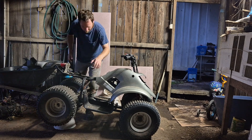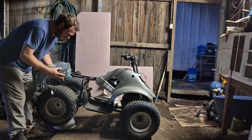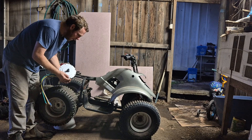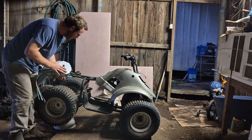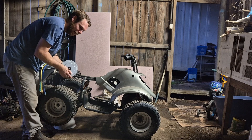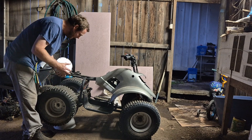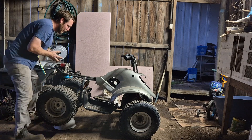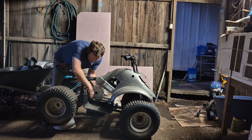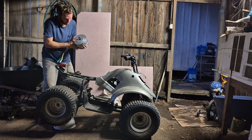So I'm going to be mounting the electric motor in here. This is the electric motor that's going to go in there. It's a 3000 watt motor and I'm going to be running it at about four and a half to 5000 watts — it's a 48 volt motor. I've got a custom made lithium battery for it, which I'll show you a video of the test run starting up. It's all electronically complete, it's just going to be housed in here. Got a few housing challenges and gear ratio challenges to beat. The motor is going to sit just in here like that — the chain and obviously a gear ratio issue to solve.